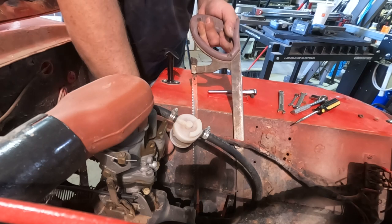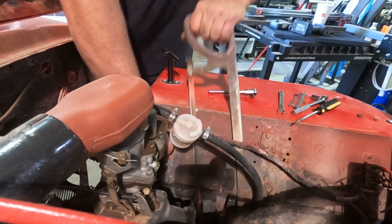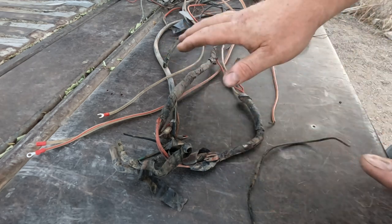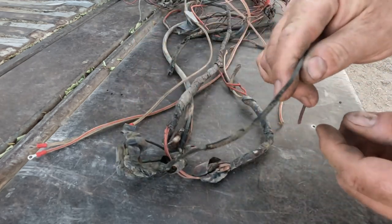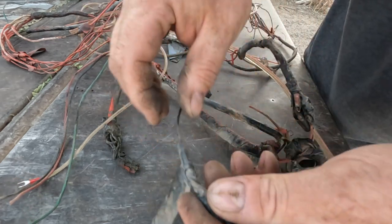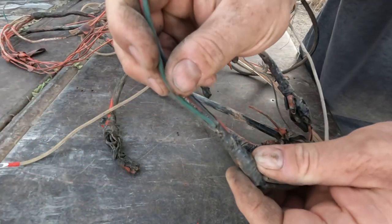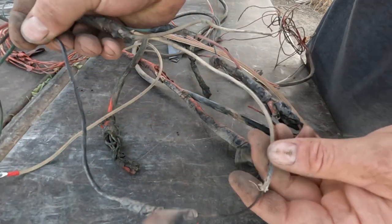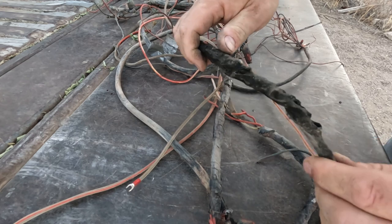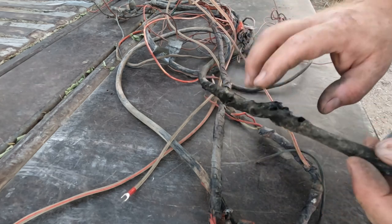Some of these bolts just don't want to cooperate — it's like they've been in place for over 70 years. I'm really glad I pulled out all this wiring completely, because we had the stuff I'd seen, and then as I got under it there's melted wires. Here I have a wire that's not bad, electrical tape going to completely bare wire, going to more electrical tape, going to wire that looks okay. So either end looked okay, but the middle was terrible. This whole section just totally melted — burned through. It had a nice covering on it, but maybe it laid on the exhaust. That definitely would have been a problem.